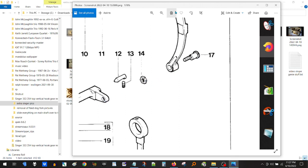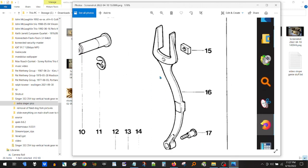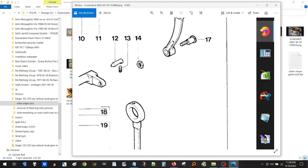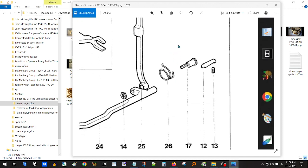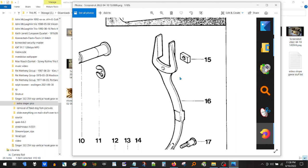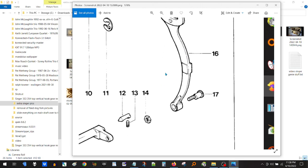And so the way to adjust the feed dog fork is by just spinning this around. As you spin this around, it adjusts one of the movements of the feed dog fork. The feed dog forks have a height movement, how high they protrude out of the top of the needle plate, and then they have a travel.